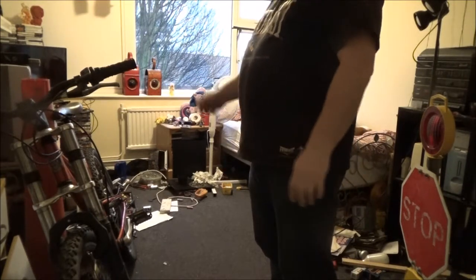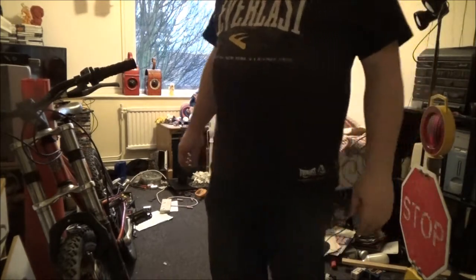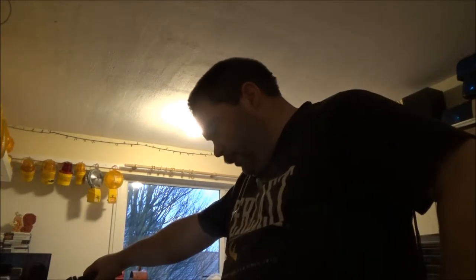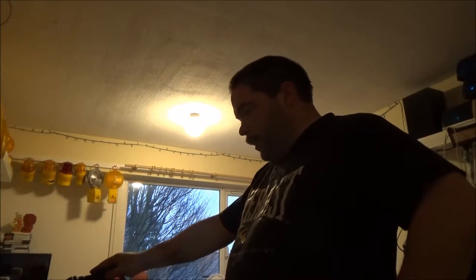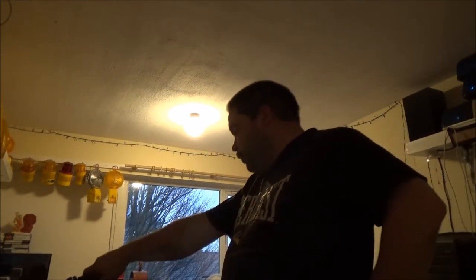On either disc — because I've had the rear one off to clean it up, but it's got those score marks on which is a problem. The discs were worn. I've still got a bit of room for adjustment on the brake, but I'm not going to bother with that because I'm changing the gear shifters on this and everything, so there's no point in me getting the brakes and everything set up because I'm going to have to disconnect it all to change all the gears and whatnot.